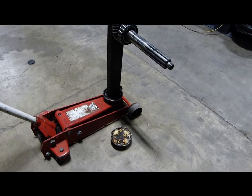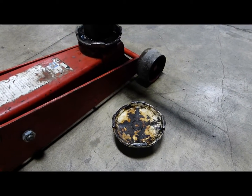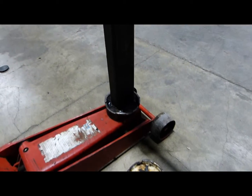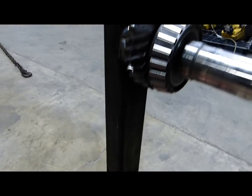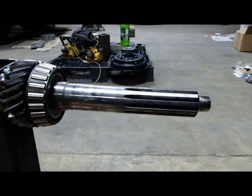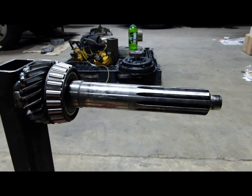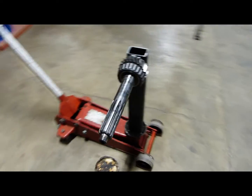This is just a regular floor jack, for which I was fortunate enough to have two jack crowns. I could use one of them as the base for the upright post, and at the top of the post we've welded an old input shaft upon which to hang the components of the clutch.